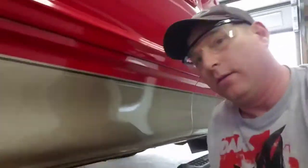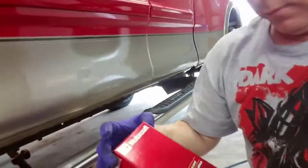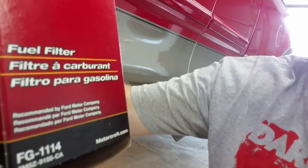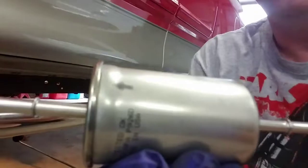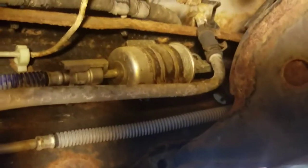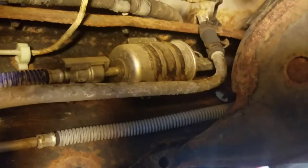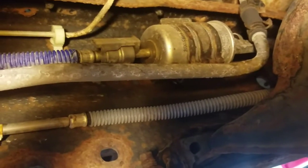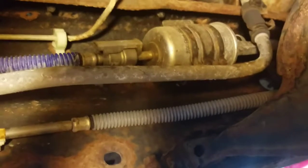I'm going to make another video here today — this is going to be for a fuel filter change in the 2001 F-150 5.4 liter. What you're going to need is the fuel filter FG-1114 from Motorcraft. It looks like this, and I'll take you underneath there and show you where it's at. Here's a look at the fuel filter for a 5.4 V8 F-150.